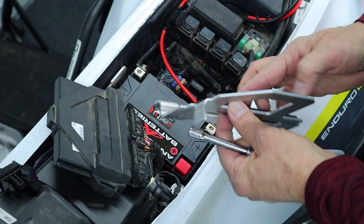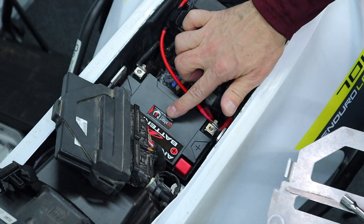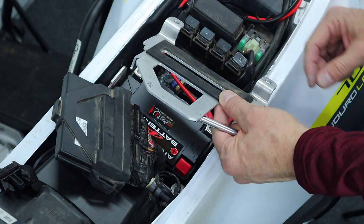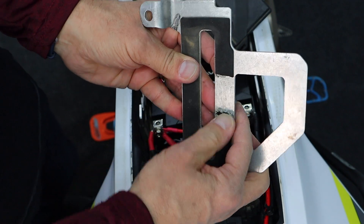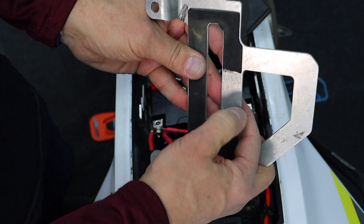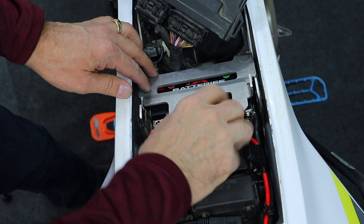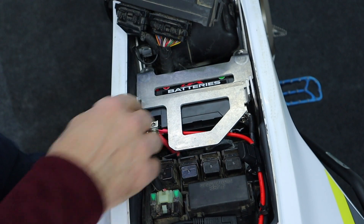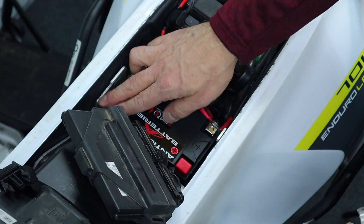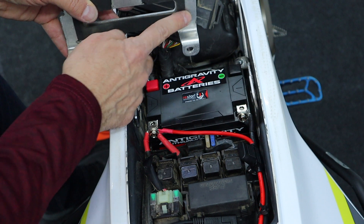It's time to put the plate back on top. This rubber gasket — in order for it not to rub against the restart button, I'm going to scrape off about two inches right in the middle. You really have to scrape because even after you get the foam off, it leaves glue behind. You have to be patient and scrape the glue to reveal just the metal so that it doesn't grip against that button. With that foam removed, it should be an easier fit. There's definitely very little room and that foam is a bit much, especially on the front edge where it's rubbing against the covers over the poles. I'll do the same and remove the foam from the two corners.